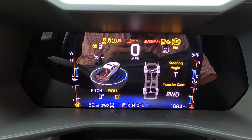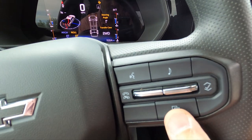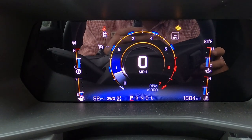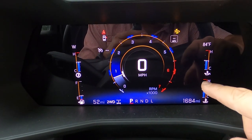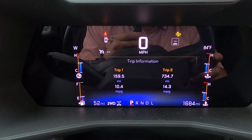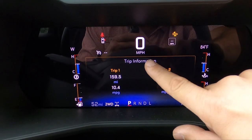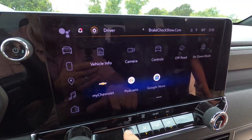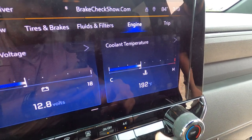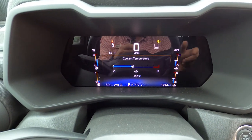You get some cool gauges — this is the pitch-and-roll off-road page, showing transfer case position and steering angle, which we used today and it was quite nice. You toggle through pages to get a calm quiet screen, or the tachometer screen — that's the only page you can get the tach, but you can't get fuel economy or a trip odometer on that page. Toggle again and you get trip information: we got 10.4 MPG towing, which is what we've gotten the whole time. You can customize the driver display — go to vehicle info, get engine info like coolant temp, click 'add to driver display,' and it will stay there while you go to other screens. That's a pretty cool feature.